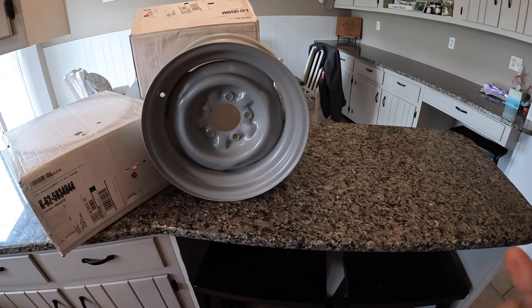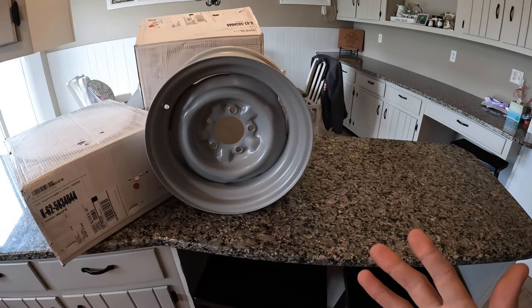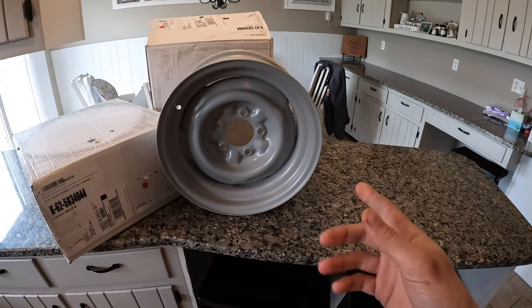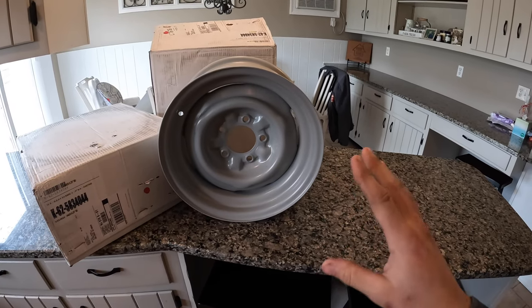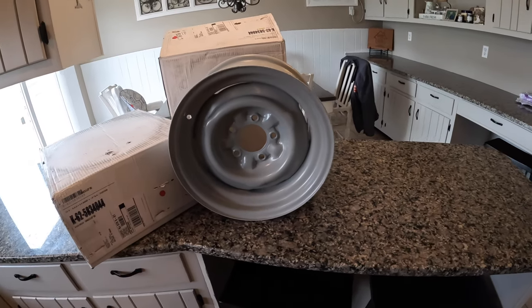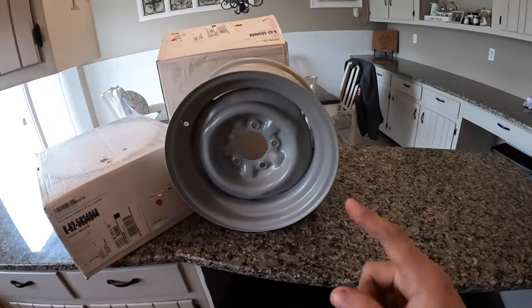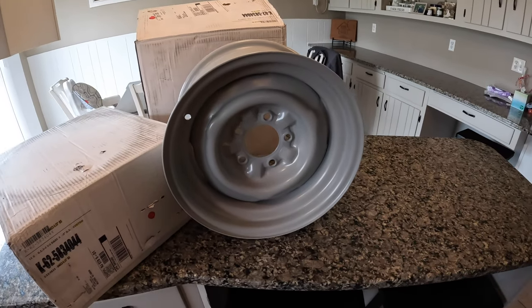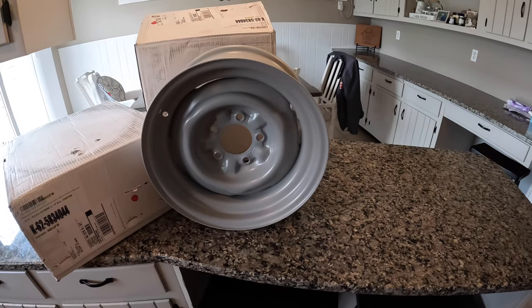For me, running a steel wheel on my green car that had that factory look, but also being able to get the widest tire possible, was pretty important. This is a 15x8 steel wheel with a center ring that fits the dog dish style hubcap. It's a Series 62 wheel. Stock, off their website, it comes with a four and a quarter inch backspacing. But in order to run a 275-60-15, you need to change that backspacing — you'll never fit it with four and a quarter inches.